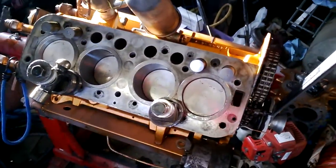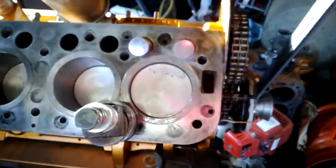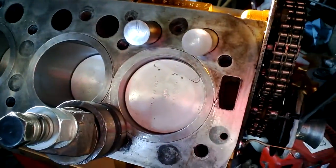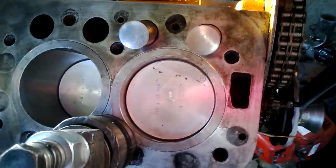Get my handy straight edge. Apologize for the shaky video. I have the engine all marked and everything. Down there are the marks — I found TDC with the piston stop method. I don't need to show that. So what I was told is to turn it around with the timing at TDC just until the camshaft is right — when these two rockers move up and down equally on each side of TDC. I believe it's these two rockers we're talking about. If so, then I have it right.